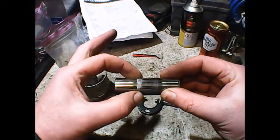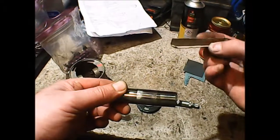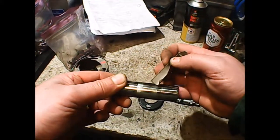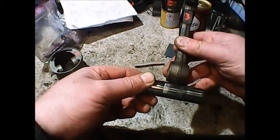There are some machining marks on here. These marks here are superficial — I used a piece of cardboard to measure it. These cross-hatch marks here are literally where it interference-fits with the con rod, so the con rod goes on into that area there.